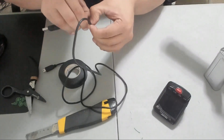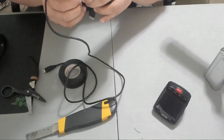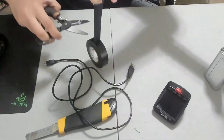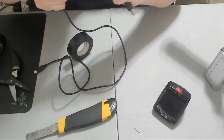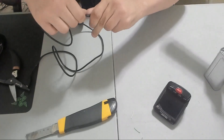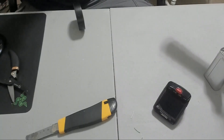What you want to do now is try to pack all the wires and wire strands back into the outer shielding. The neater you do this, the better the finished product will look, so take your time. Once you've repacked the wire, grab your electrical tape and cut off a small strip to reseal the wire. Start at one end and wrap it tightly around the wire, and with that you're done. Your new modified wire is now ready for your dash cam — plug it into your car and you should be good to go.